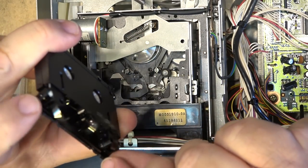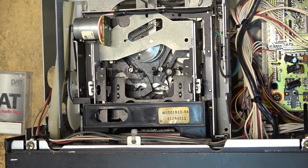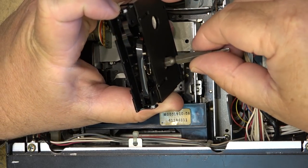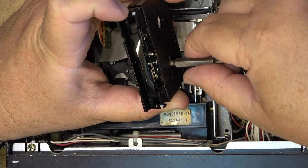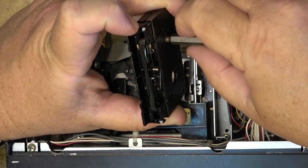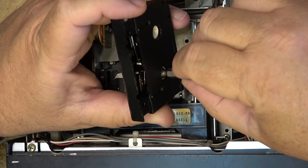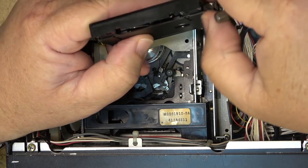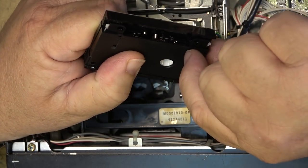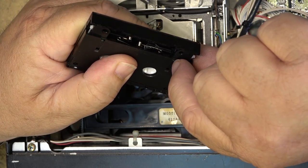This is a tape that got damaged before and I had to fix it, so that's why I use this one. I'll spool this tape back onto its shell. Good old screwdriver bits are perfect for spooling these small tapes back into their cassette - perfect size. This also works for eight millimeter videotapes but not for mini DV as their hub size is a little bit smaller.